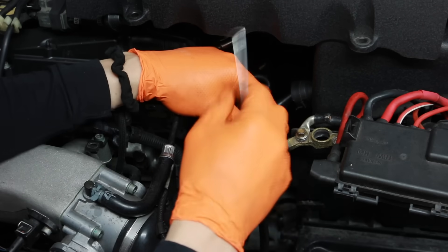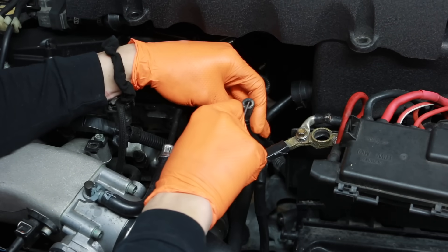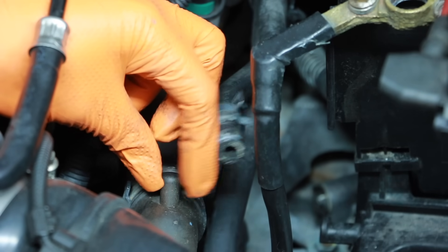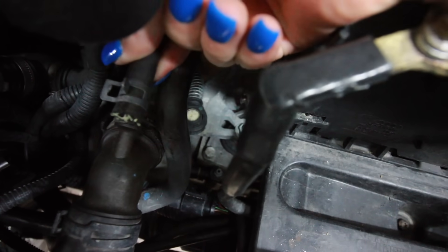Just barely grabbed this upper line so I could connect the top coolant hose and the plastic fitting — the coolant fitting broke off inside of it. I just ordered that little plastic housing piece that is cracked on here. They have it in stock at the auto parts store so I'll go pick that up in the morning. I just trimmed the hose back a little bit where all the busted pieces of plastic were inside there, and there's still plenty of room to connect it. So I'm going to clean up for the night before I get the urge to push the car out in the driveway and set it on fire.